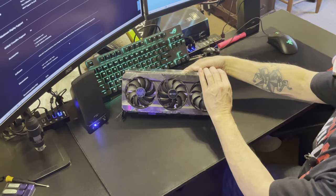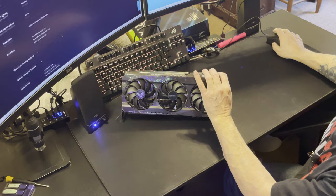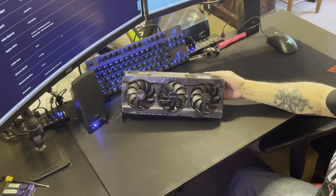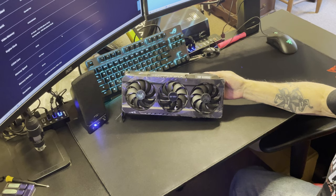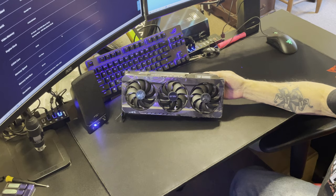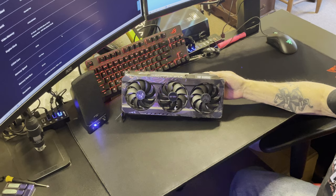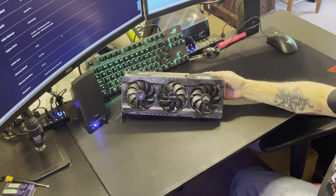let's do a rundown on the specs of this. So the graphic engine obviously is a 3090 NVIDIA, bus speed PCI Express 4.0, OpenGL 4.6, video memory 24 gigabytes. OC mode on it, this is boost clock, not game clock, game mode. So OC mode is 1725. I know this card can go higher than that if you want to play with it and do your own settings. Gaming mode 1695. CUDA cores 10,496. Memory speed is 19.5